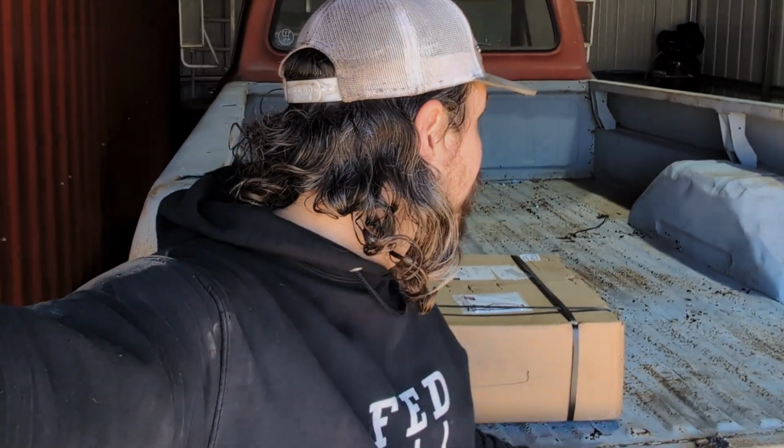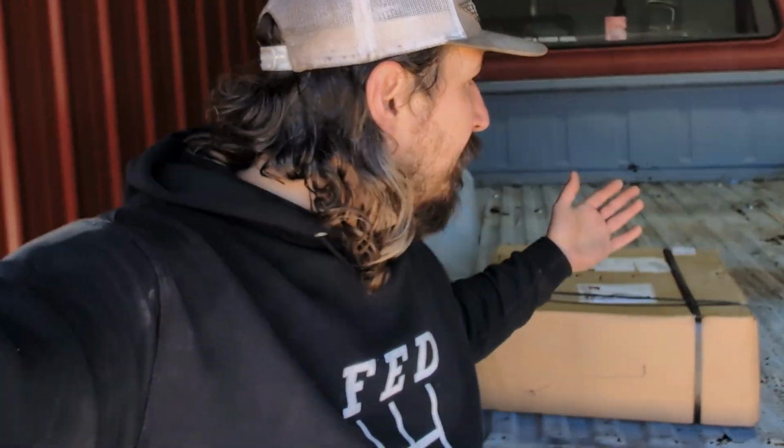Alright guys, welcome back. If you remember in the last video, this Cummins is just annihilating the clutches in this thing. Stock clutch, stock replacement, I don't really know. It came in that dually flatbed when we bought it. I thought I could limp it by. I could not have been more wrong. Boost controller unplugged, minimum boost, quarter throttle, she just zips right through the clutch.